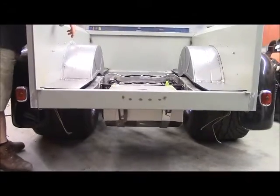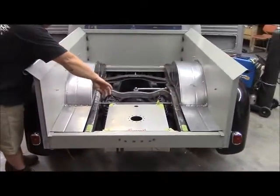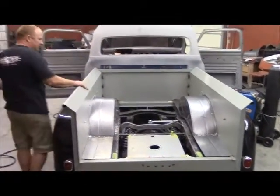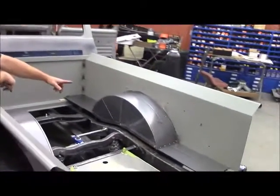For the gas tank I put a fuel pump inside of it. I made a little basket with a fuel pump that'll go down in it, I'll weld the back back on, and I made the fuel lines go out of the back of the tank into the frame rail — boxed frame rail — and back up to the front.